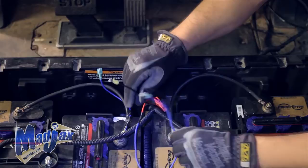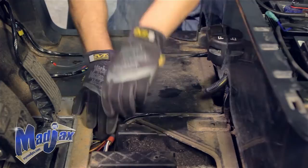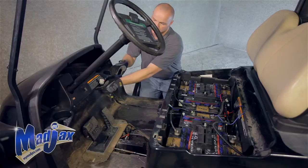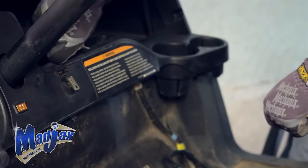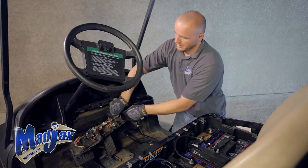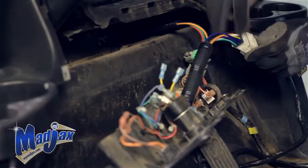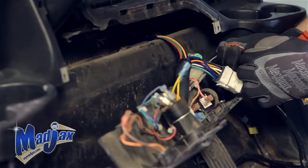We're going to leave enough wire so that you can hook up to your battery pack. Now that we've run our bucket harness through our access hole, we're going to take our brake switch wires and run them through the center channel and securely tuck them inside your brake cavity. Next, we're going to take our 12 pin connector harness, run it around, and slide it into the passenger side channel — this runs all the way into our dash. Now we're ready to remove our dash; we're going to remove three factory bolts. With our dash removed, we're going to hook up our bucket harness to our light kit main harness, which is the one that runs to the front bumper and headlight. We're going to plug your two 12 pin connectors in, as well as plug your gray wire from your bucket harness to your gray wire on your factory Club Car harness.